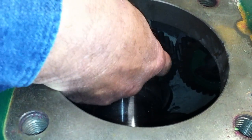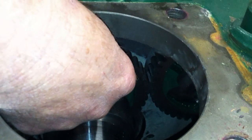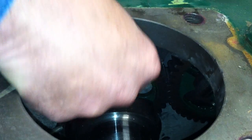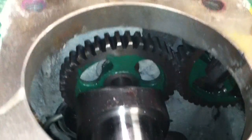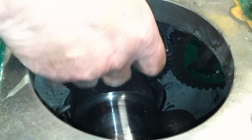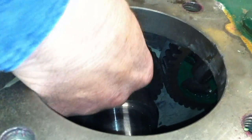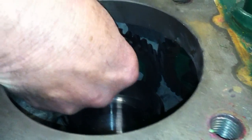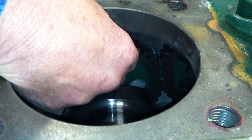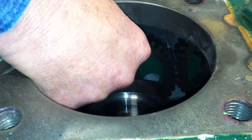Now we're going to get the gear down in here. You'll notice that it is not going to mesh because of the way the straight cut gears are. So you're going to turn the crank backwards toward you to get it to fall in. Then we're going to go the other way. If you're watching the cam, it should never turn while you're doing this — the camshaft will never turn. I'm going to do this again so you can see it again. Notice the gear backing out. We've got the gear loose right now. We're going to go back to top dead center exactly with the crank. If you've got the cam away from you on the far side when you're working on it like I am, you pull the top of the flywheels back toward you and the gear drops in.